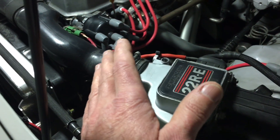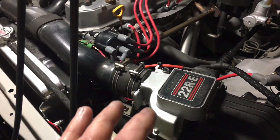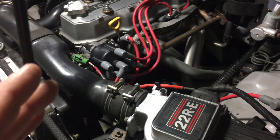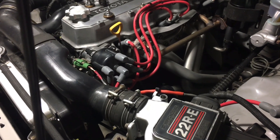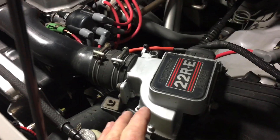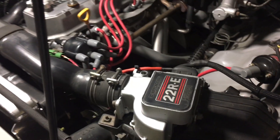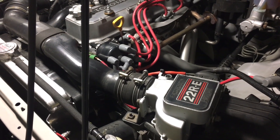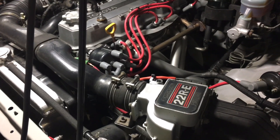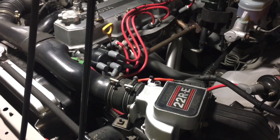They're both tricking the ECU in terms of how much air it's seeing, and that translates into one of the attributes the computer uses to figure out the duration to pulse your fuel injectors — the pulse width — which has a direct impact on your air-fuel ratio. It can sometimes be a little confusing to understand what's going on here, especially with this screw and getting out of whack. So 12.5 millimeters is probably a fair starting point, and from there it's a matter of adjusting based on the overall operation of the vehicle and how the truck idles when you come to a stop. I'll put links to pertinent information in the description, and if you have questions I'll do my best to answer them in the comments. Thanks for watching.